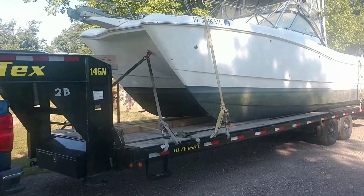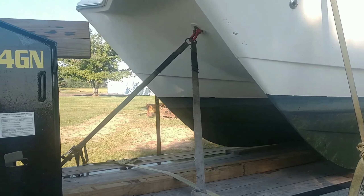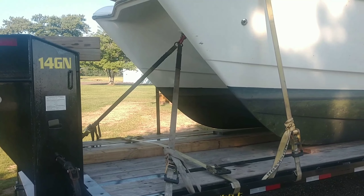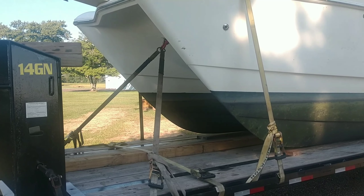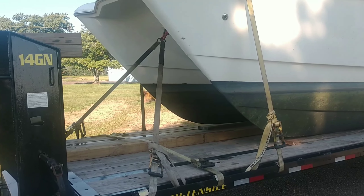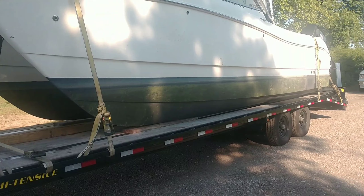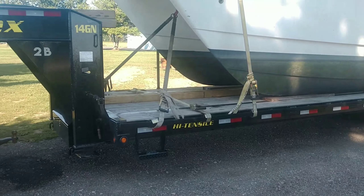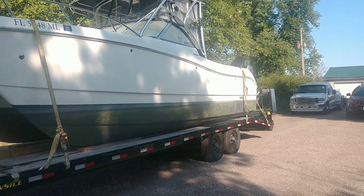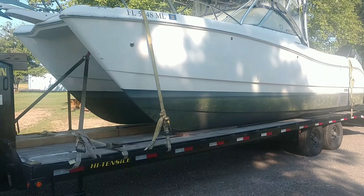There was actually a line behind me and a line in front of me. I actually waited up there a couple hours to get loaded. That's okay, no big deal, it was expected. So tying these down - you pull basically like you would do anything else on wheels. You would pull it in four points at least, front you pull forward or backward, and the back you would do just the opposite of the front, either forward or backwards. So we have the front pulled forward, the back pulled back, and I actually threw two other straps clean across the boat just to help stabilize the center so there's no rocking of the boat going down the road.